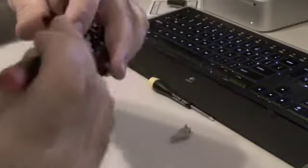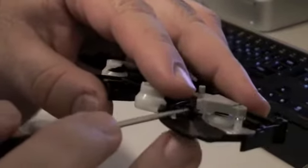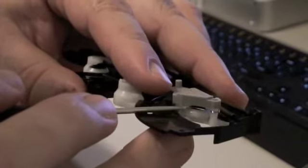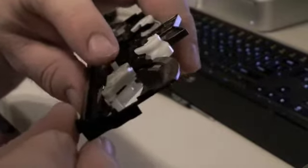And then dig your spring out from underneath. Oops. It takes a little bit of doing. What I'm trying to do is put the spring over the small catch on the gray guide. There we go. It's a little hard to see, but right where the edge of my screwdriver is where you want to put that long part of the spring. Right over this there's a little nipple here that you put that spring on, and then there you go. You test it to see if it springs back, and then repeat for the other side. And there's the right hand side.